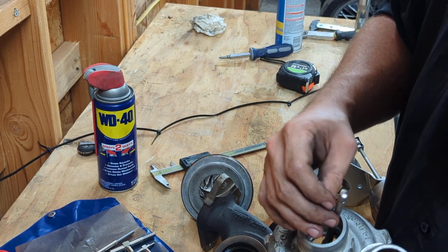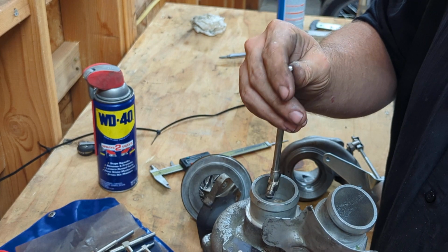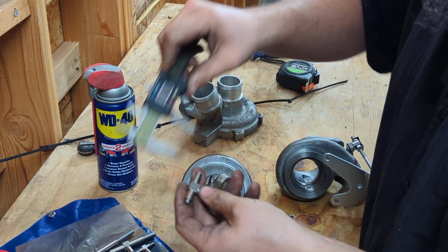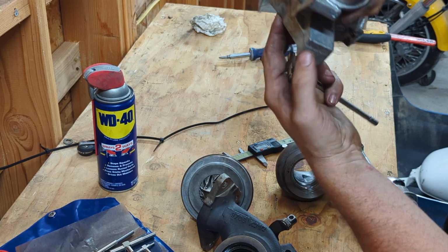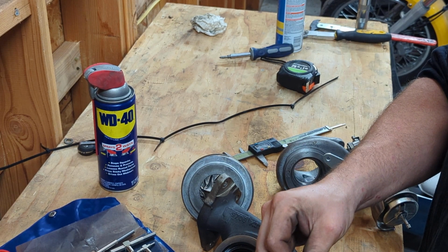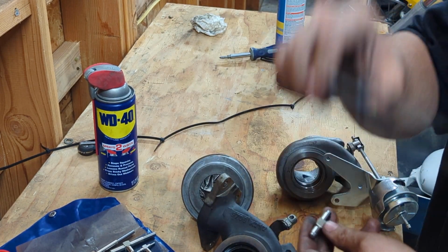These actually taper, so if you come down here and measure, you're never getting that out. That's one of the things I corrected on my custom turbo. Straighten this out because it kind of bottlenecks and then opens back up. Don't know why. I didn't machine them that way. 38 millimeter inlet. So your compressor wheel's 36, your inlet's 38. These have a slight choke point right here. If someone were careful enough, they could port that and open it up just a little bit. I don't know how much wall thickness is there though, but I mean, the Chinese turbo that I'm machining, it was 200 bucks. 38 on the nose. So the 2.7 actually has a slightly larger outlet.